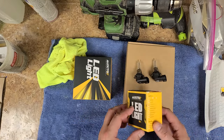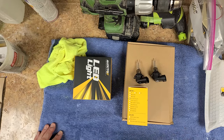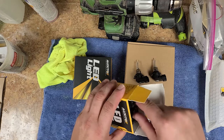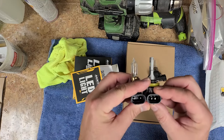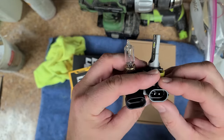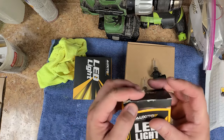The seller said what I have are H11s. But every time I look at my vehicle, both the high beams and low beams are the 9005s — I don't have H11s. This wasn't equipped from the factory with LED lights. The seller insisted these were what I needed, so I picked them up. They're still in the box because the plug is not the same — the prongs on the 9005 are spaced further apart compared to the H11s. Back in the box they go.